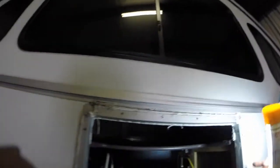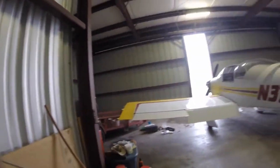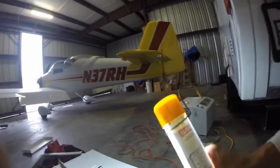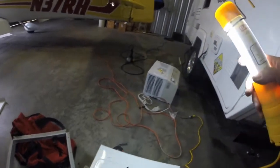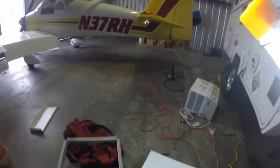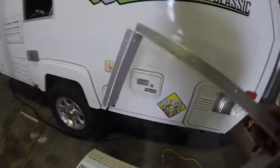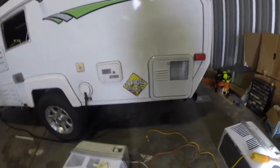You can see this metal stays in — that's what was holding it up a little bit. You've got to just cut that with a razor blade. This stays with your A-liner. There are the old holes — you're going to pick up that hole pattern for the pop rivets. If you do one from Home Depot or overstock, you're going to have to remove this bracket and mount it on the new one. First we're going to take apart this and see what A-liner has done — reverse engineer it and beef up our new cheap $145 one.